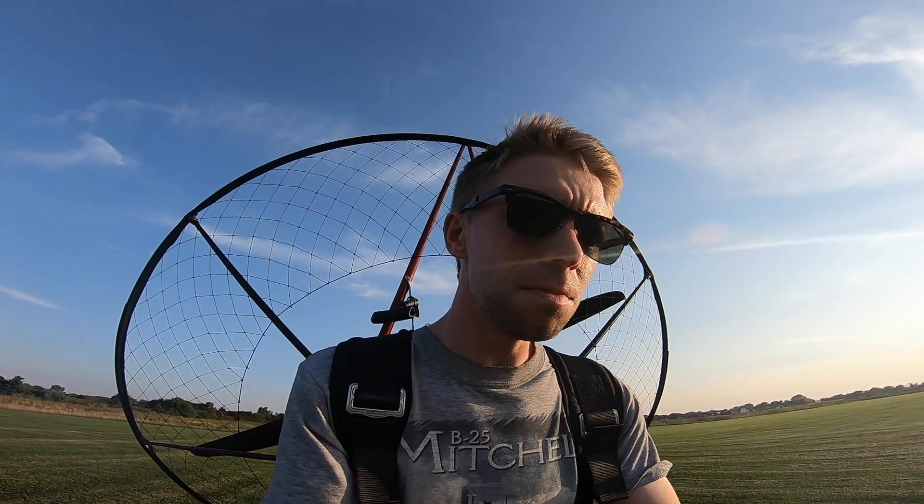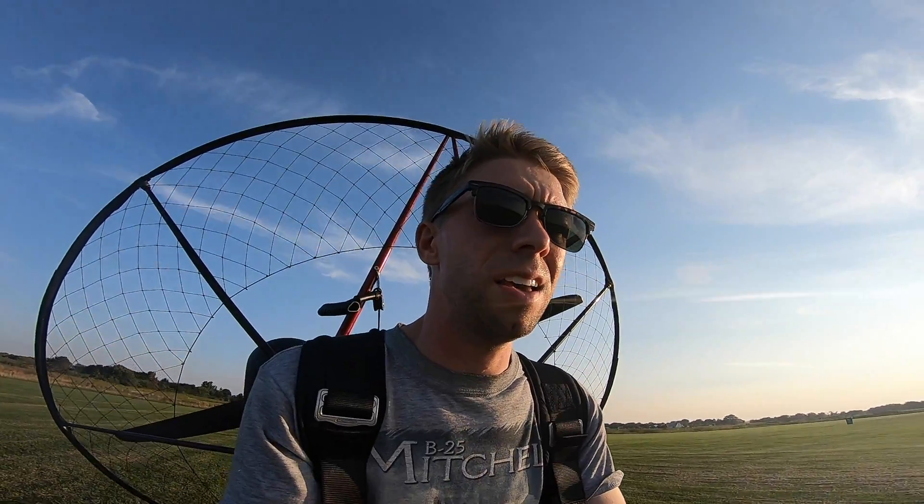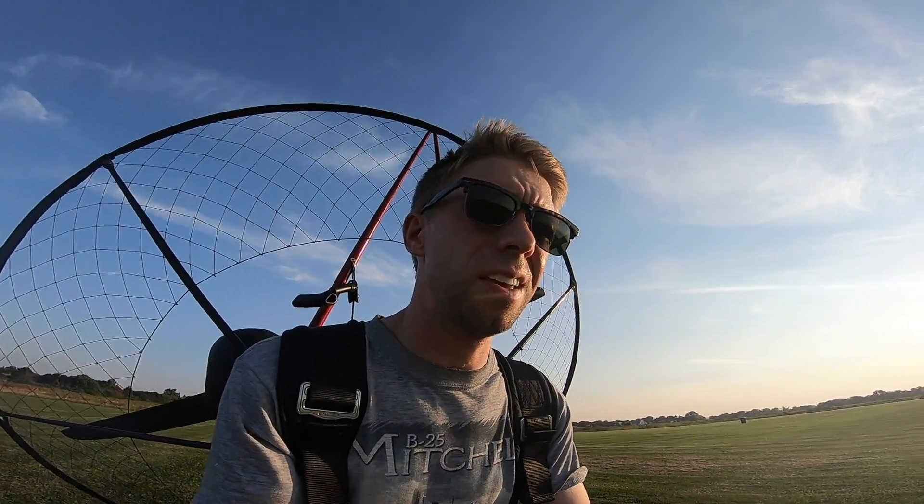Then I'm going to descend below a thousand feet — launch elevation is about 900 feet — smoothly roll on full power, start a timer at a thousand feet and stop the timer when I hit three thousand feet. I'm going to know RPM at three different altitudes and stabilized cylinder head temperature in the climb. I'll record the time to make that two thousand foot climb, and I'm going to do two of those for each propeller.